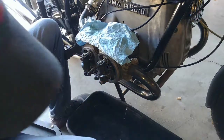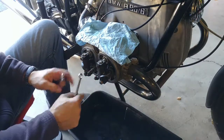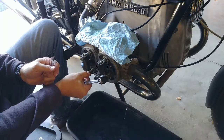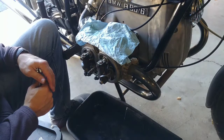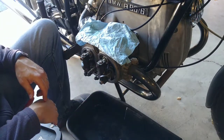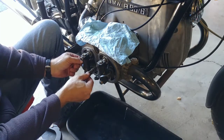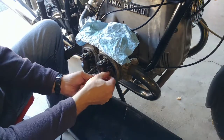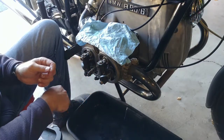Okay, that's it. Torqued all around, adjusted, and this just gets tightened by, you know, by feel. They have a torque setting for that as well. And I'm gonna slap the cover back on and then do a test run. And I hope some of the noisiness on this side has gone away. I have another. This one here seems so nice that I don't wanna replace him yet. So I'm gonna save the other $24 worth of bearings for another day.